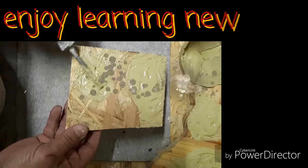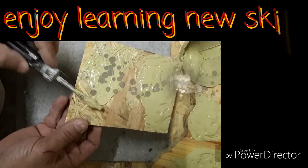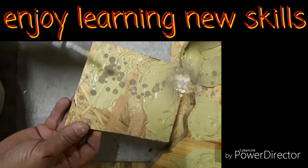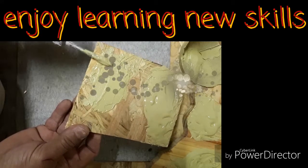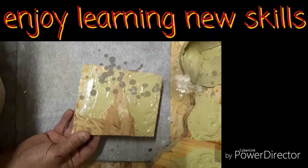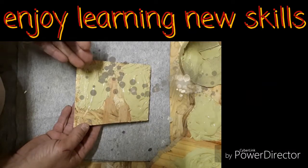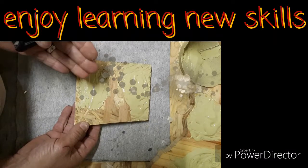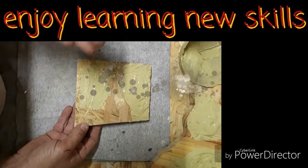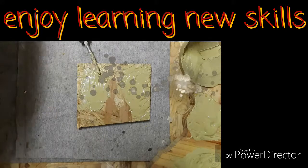At this stage, this is basically where you're gonna have to smooth it off like that. You just apply it, smooth it. Also, before sanding this, rather keep to about a half an hour to an hour before sanding it. It still stays sticky and it will just pack up your sandpaper.